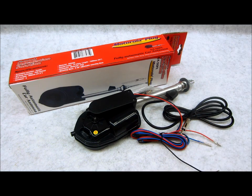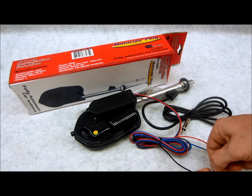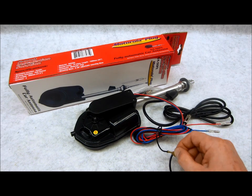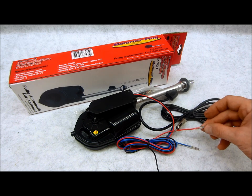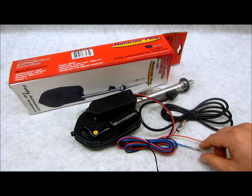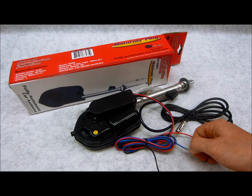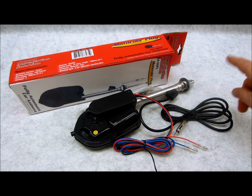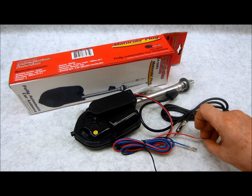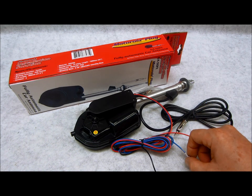On the side of it you're going to have three wires. Black is going to be for constant ground — I'll just take my black wire from my power supply and twist that onto this black. So the black is constantly always grounded. Then you're going to have your red and your blue. On some vehicles, the red is going to be a keyed accessory 12-volt wire. Blue is always going to be the turn-on, so when your factory radio or aftermarket radio turns on in tuner mode, this is going to get 12 volts which is going to take the motor and turn it on.